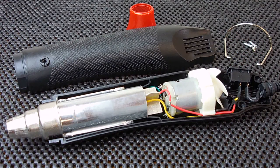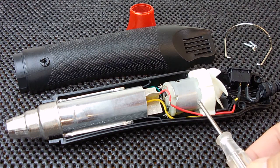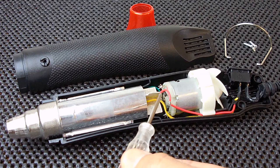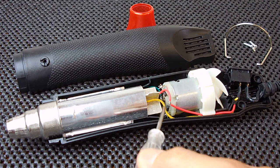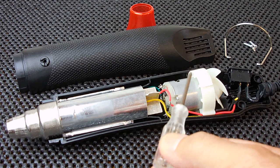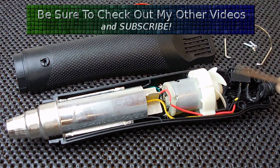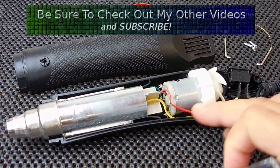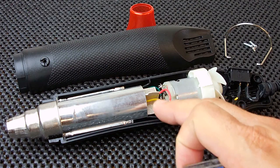Here's a look at the inside of this mini heat gun. 120 volt power supply enters the unit, there's an on/off switch, and a DC motor rated 120 volts DC. Right over here there's a diode — actually four of them — making a full wave bridge rectifier, converting the AC into DC to drive that motor. The fan rotates pushing the airflow through these holes, directing it through this metal tube where the heating element is wrapped around this mica insulator.